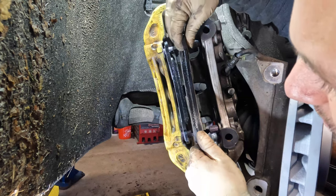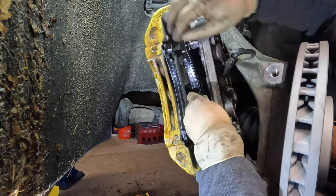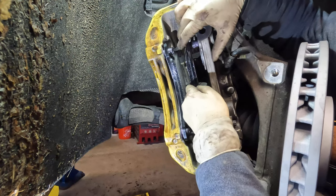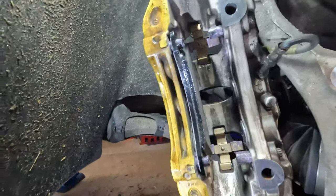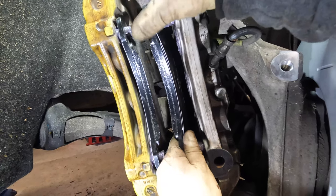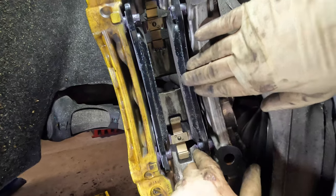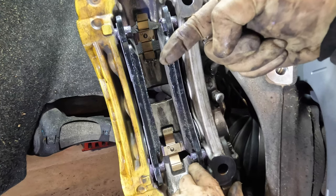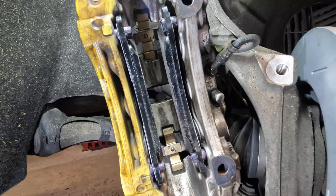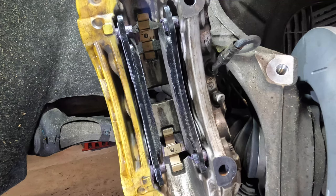I'm also going to do the other side on camera. It's just like a little spring effect you've got to overcome — pushing inward as you push back because that little tab on the cross is pushing out. Once you have them on, wipe your hands again and make sure they're firmly seated. Now we're ready for the next step: installing our caliper back into our knuckle and onto our rotor.